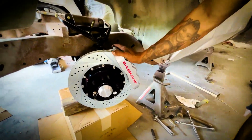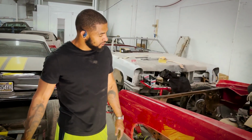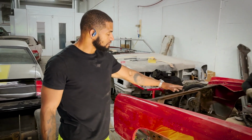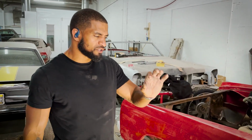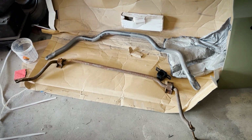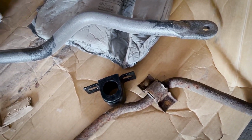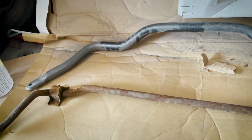So we do have the full kit. When I say full kit, that's upper and lower control arms, all brand new suspension components, your center link, inner and outer tie rods. But also, QA1 comes out with a more robust, probably a 2-inch or an inch and a half sway bar that comes along front and rear with the kit. So we're gonna put the sway bar on, just kind of get a total fitment of it, and then put the 26s back on it. And at that point, now we can go back to adjusting the wheel well for clearance.